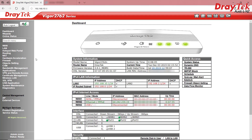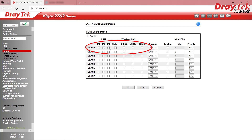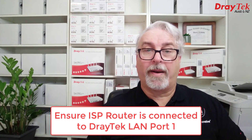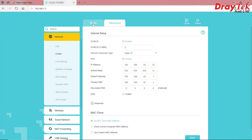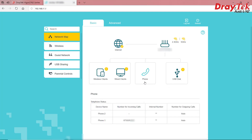And then set it on the LAN settings on our Draytek. Log back into the Draytek and go to LAN, VLAN and click Enable. For VLAN 0, which will be our main local area network, we'll tick Port 2 and Port 3, plus any wireless SSIDs we have. You may notice Port 4 is missing here, and that's because Port 4 is configured as our WAN port in this example. Then for VLAN 1, we'll tick the box under Port 1, enable VLAN Tag, and enter a VID of 2 and click OK. Now anything plugged into Port 1 will get a VLAN tag of 2, so we need to make sure the ISP router is plugged into Port 1, and then log back into it to see if we've been successful. We might have to give the ISP router a reboot at this point, but when it comes back up, we should have phone and internet all working happily.